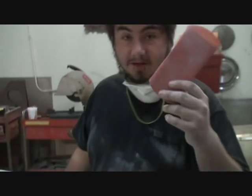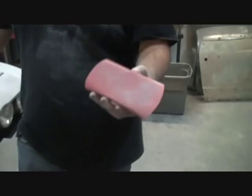Got to make sure that you use the right grit. It's 220. Okay, so you're using a DA paper there. Yeah, it's DA paper. Now, could people get 220 in a regular stock file paper? Yes, they can. Okay, so you got to roll a 220 out, and you're sanding it with the 220 right now. Now, what are you using to sand that with? It's a block. What kind of block?